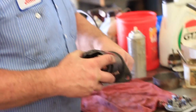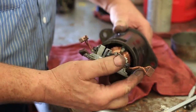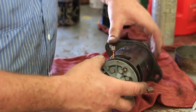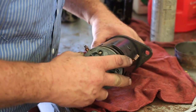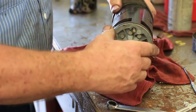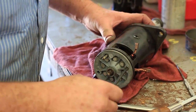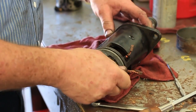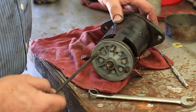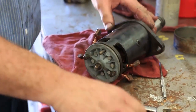So we're going to quickly put this thing back together and try it again. We're just going to put this back together — there are alignment pegs on here to get it all in the right place. Get our hole here and get our brush through here, and try to get this guy in without anything getting shorted. The shop rule is: don't rebuild most starters, because most starters don't want to be rebuilt — they fight with you. You really want to send them to somebody who has all the knowledge and experience and has done them a lot.